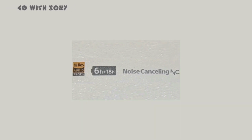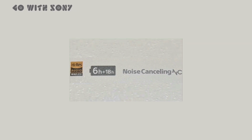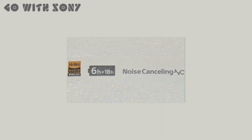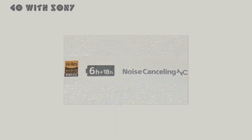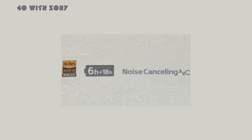We can try to look at some recent Sony headsets for guidance. The retail box for the WH-1000XM4 shows 30 hours for battery life. Same for WH-1000XM3. Looking at the available operating time for the XM4, 30 hours corresponds to 2 settings. First is LDAC, DSEE Extreme off, speak-to-chat off, NC off. Second is AAC, DSEE Extreme off, speak-to-chat off, NC on.